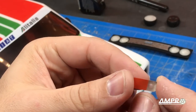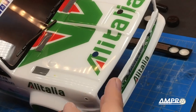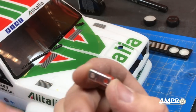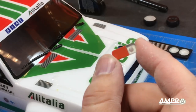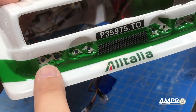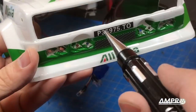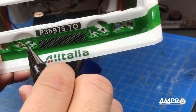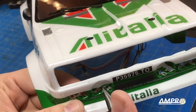I want to show off the front turn signal slash parking light. I put some chrome paint on the back so that none of the green decal shines through. There are also several paint schemes for this car, so it's possible that a darker one would make the orange or clear look the wrong color. Unfortunately, due to their geometry and where the LEDs have to go, there's no way to install these other than using a flexible adhesive — I'm going to use Shoe Goo, but you can also use a clear silicone adhesive. Before we do that we should prepare the body: we need to drill a five millimeter hole here and here, and make sure the small holes are large enough to accept the LEDs.